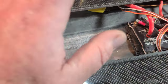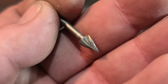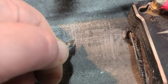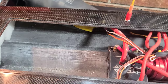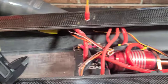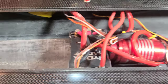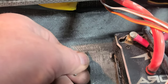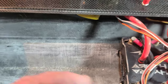The most important part is prepping up the work area. I'm going to use this Dremel bit and scar into the hull, do some cross-hatching where the tray is going to go. You're filling it in with epoxy so you could gouge into the hull. The hull itself is 1.3 millimeter thick, so you have a little room to play but not much. If you use something with a sharp point to rough up the surface, be careful.